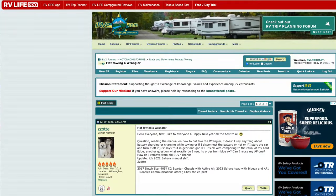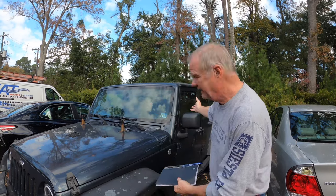There is a post on there where a gentleman took all of the research and said it's the number one question that gets asked on the iRV2 forum. A Jeep Wrangler is the number one towed vehicle and most people flat-tow it. What they told us is you must leave the key in and in the number one position, which does take about two amps of battery. And then you have to make sure that you start it up every four or five hours, or you could install a cutoff switch, which is what we're going to do.